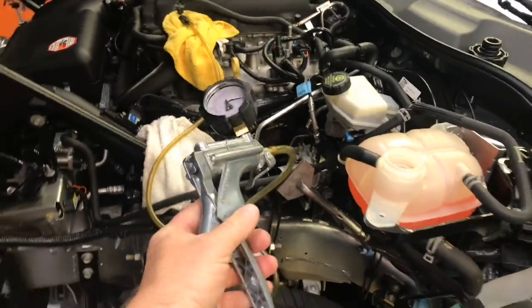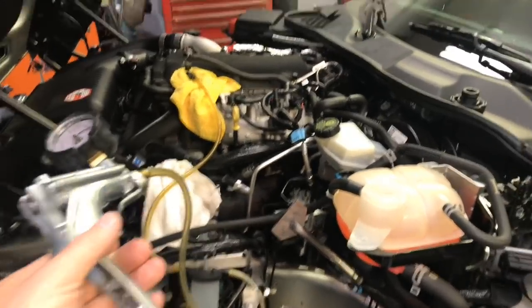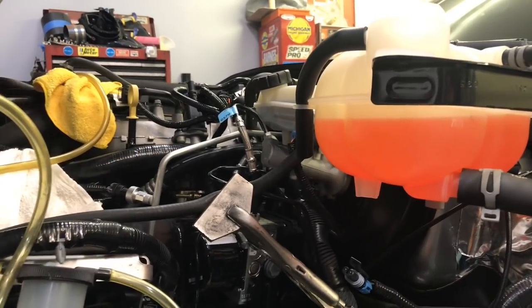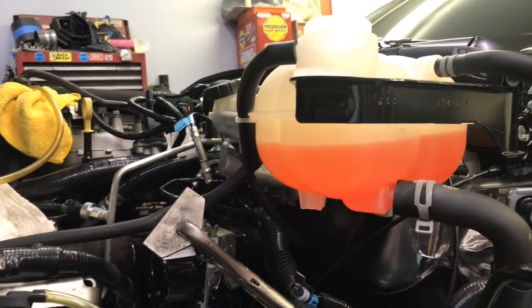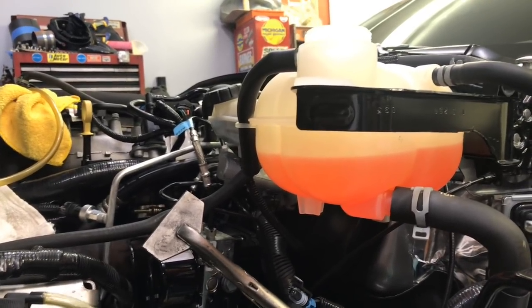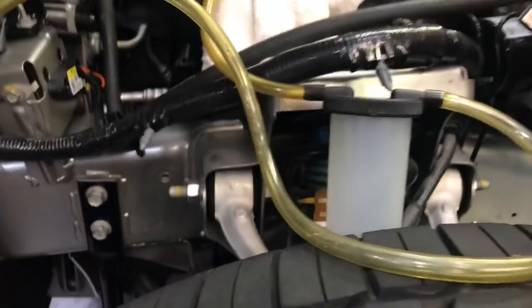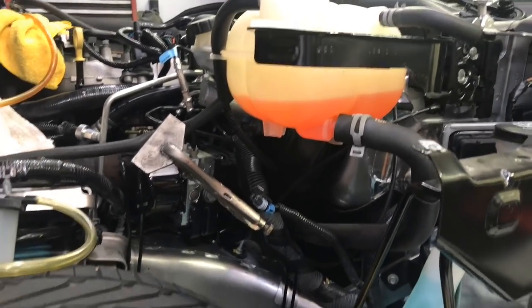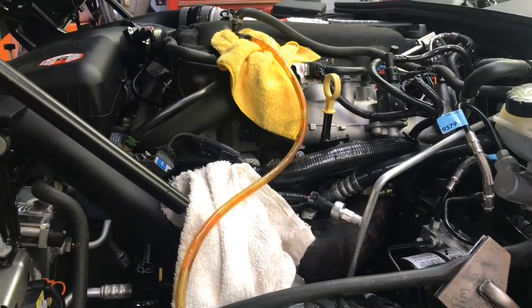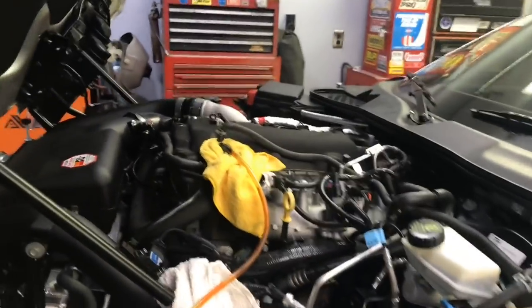I've got the vacuum gauge out and I'm creating a little vacuum. You can watch the coolant level being drawn down each time I pump — you can see it being pulled out through the upper bleed in the cylinder head, pulling out quite a bit of air and drawing coolant into the system. I finally got a little bit of coolant out, so I've now bled all the air out of the system all the way to the top of the bleed.